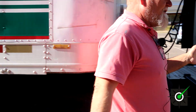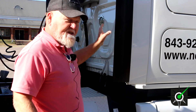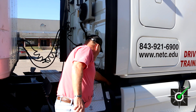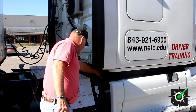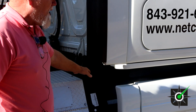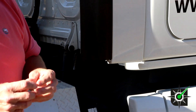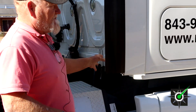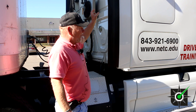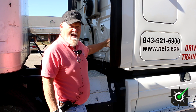With our truck we have an exhaust — we don't have a stack, we have an exhaust, but it's all the same thing. That's it underneath the cab, bolted on with clamps. It's not bent, not cracked, there are no holes in it, it's not damaged. If it had holes or cracks in it, there'd be soot trails on it — and that's the very same thing for a stack too. It bolts up with clamps and brackets. Everything's got to be tight, properly mounted and secure, and there can't be holes or cracks in it.